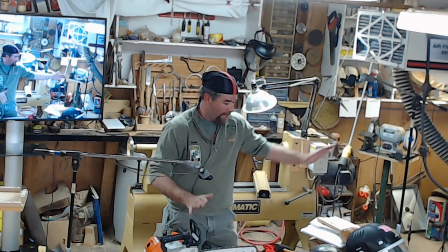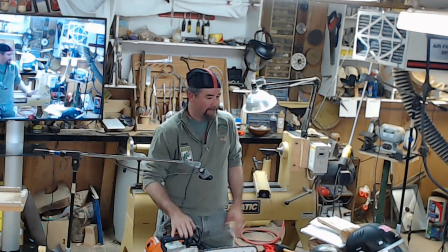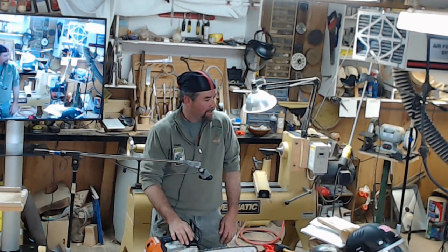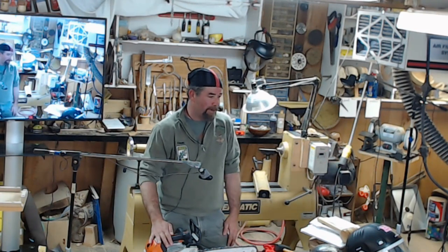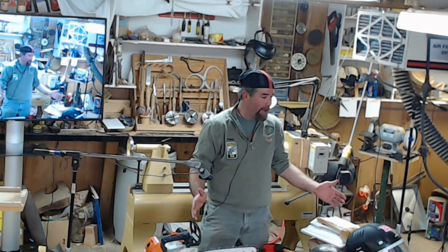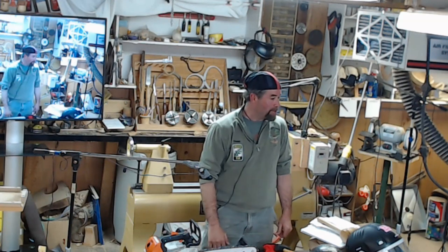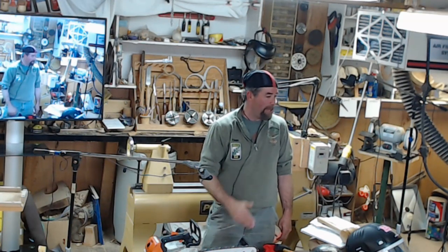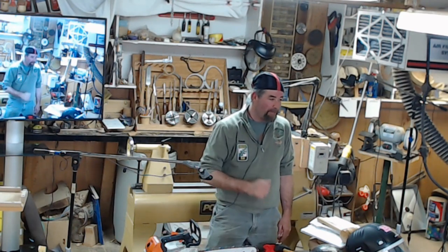I can point them up a little bit, but once they get dinged, I have to take them to get sharpened on a machine, because there's just too many teeth. It could be 130 teeth that I've got to sharpen. There's no way I'm going to have all those perfect. So I'll go take them, because that chain's $75. It's not worth pitching it, and it's got, you know, three quarters of its tooth left on there still. It's worth paying $8 to $12 to go get it sharpened and have it perfect again.